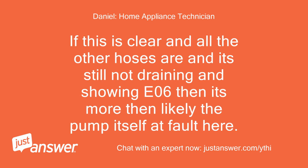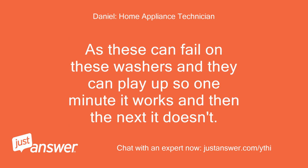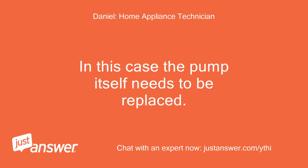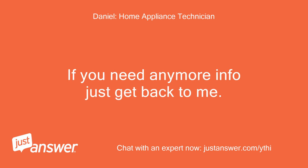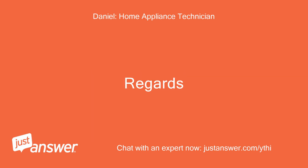If this is clear and all the other hoses are and it's still not draining and showing E06, then it's more than likely the pump itself at fault here, as these can fail on these washers and they can play up, so one minute it works and the next it doesn't. In this case, the pump itself needs to be replaced. So check that out and see what you find. If you need any more info, just get back to me. Regards.